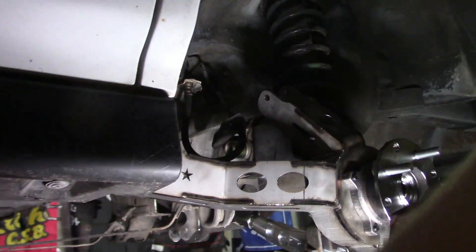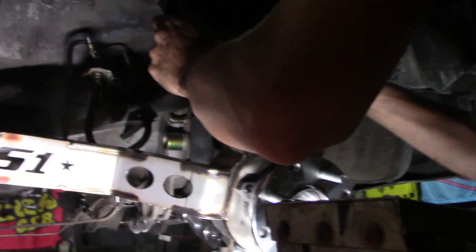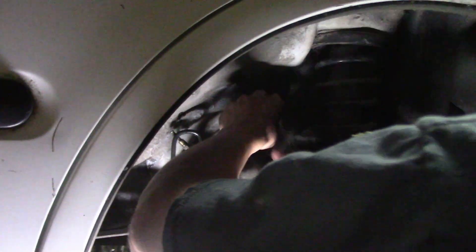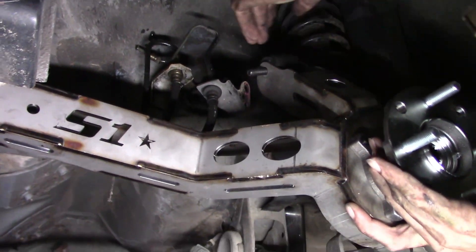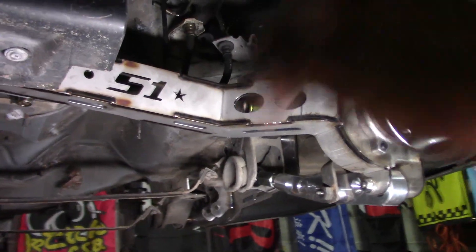All right, the HRG lift kit came with an adjustable one, so we'll throw it on there — there's our HRG control arm. That's obviously not the right bolt. Okay, that just does not want to cooperate — I'll tighten up everything else and then come back to that. All right, well I got that in there. I just had to adjust the control arm down here, and then I adjusted this one out also, and then everything lined up fine.